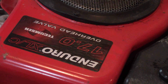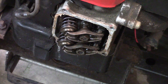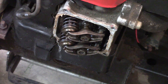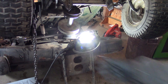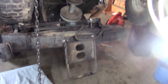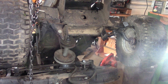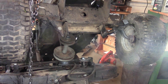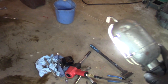This is a Tecumseh Enduro 17. I think they have plastic compression release parts, so I've got to pull the engine off. We'll open it up and see if the internals on the camshaft are broken. The tractor is jacked up. I dropped the deck bracket to get access, pulled out a 5/8-inch nut to get the pulley loose, and now there are four 9/16-inch bolts holding the engine in place that I'm removing with my impact and an extension.